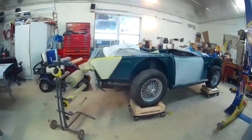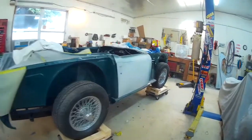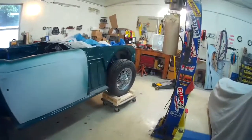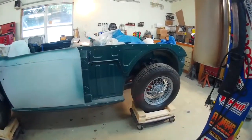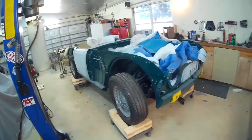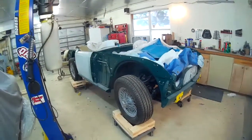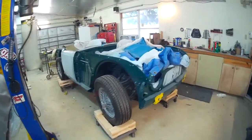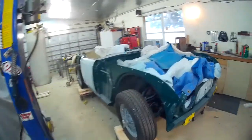Got them all done. Without any blocks on the jack, the two rows plus the wheel dollies are just as far as the jack could go. So if I decide I need it higher, I will get to use my little extension block. I think this is going to be handy — while I've tightened up most of the bolts on the body, I'm sure when it gets to final assembly I'll need to be jockeying something. This will allow me to crawl under the car, make those adjustments, and still have the full weight on the wheels so it won't change once we get it off the blocks.